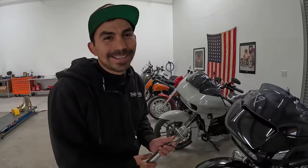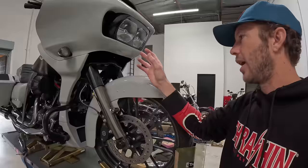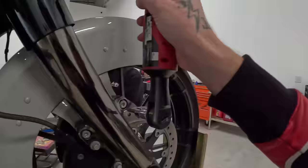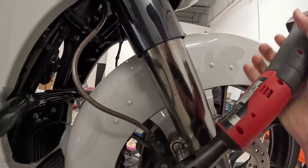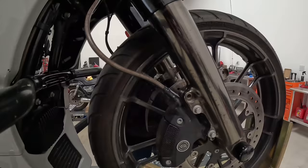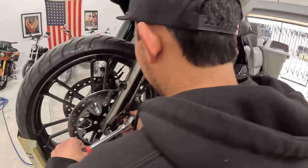We need to get the front fender, front wheel, and forks slid out so we can get the lower tree out. Juan warned me my rotors feel very bent — we'll replace them when we swap to a black one. I'm gonna grab a quarter-inch socket to bang through this. Watch, it's already loose — cracked it loose. One out, two out. One-handed holding the camera — there you go, just guide it, don't scratch it. Brakes off — don't lose track of your hardware.